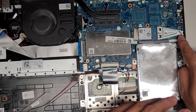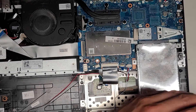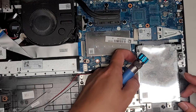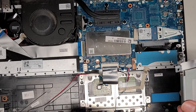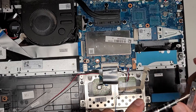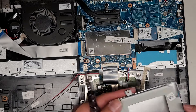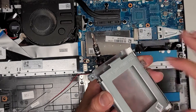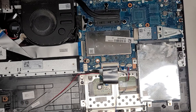There's a screw under the SSD — you pull it up at a slight angle and then pull it out. For the hard drive bracket: there's actually just a metal bracket here with one screw. If you put a hard drive or SSD in here — a 2.5-inch SATA — you transfer these screws over and throw away this metal bracket. The metal bracket is just there to hold the screws in place.